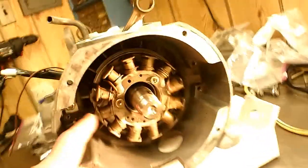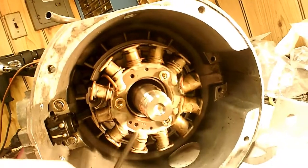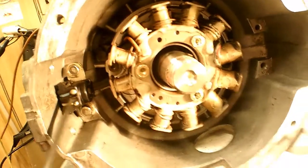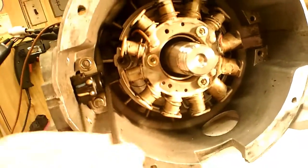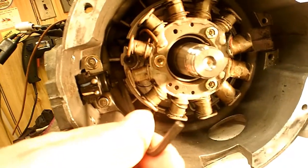It's a split grommet — there's a cut right here on it, and you have to feed the wires through this way. There's a cut right there where you can put the wires from these lighting coils in here, and also there's a wire coming from this sensor right here, and you have to feed those through here. You can see a slot made for the sensor going that way.